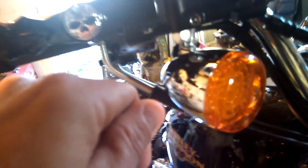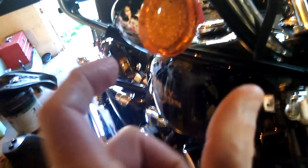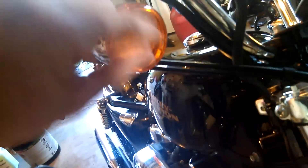So I came to the front, popped this off, popped the bulb out — very easy to take out. Get this little cap here, there's a twist on it, and there's a piece underneath. Stick a little screwdriver in it, twist it, and that thing pops out. Take the bulb out, plug-and-play install. You've got some cable on there about that much, so you kind of want to twist and turn it, put those in, and put your lens caps back on.